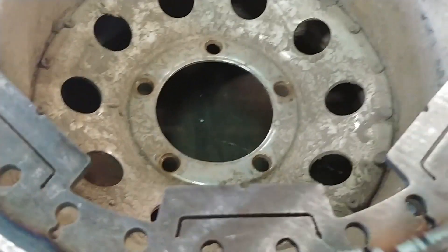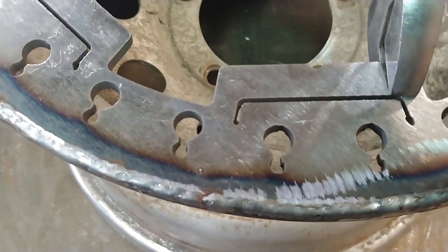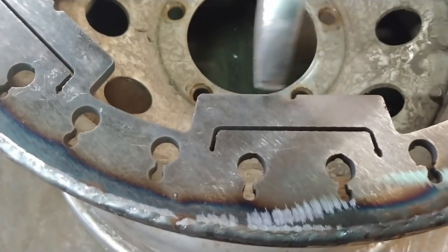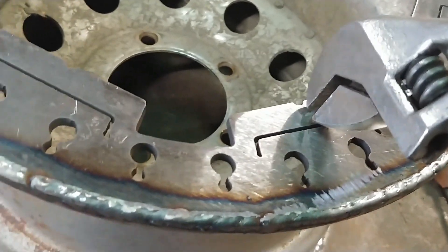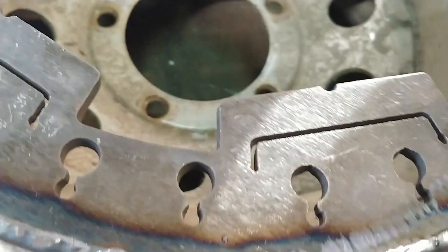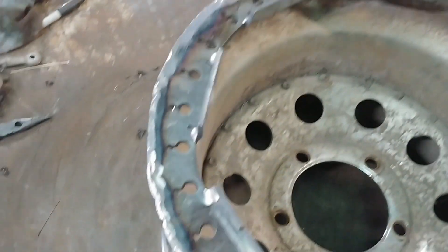The anti-coning ring — what you do is put your crescent wrench on there and bend it up. Move over to the side, bend up a little more, keep moving back and forth until you have this lip bent up 90 degrees, roughly. There they all are, all bent up 90 degrees. I'm guessing what that does is it adds rigidity to the ring and keeps it from coning out when you tighten down all your beadlock bolts.